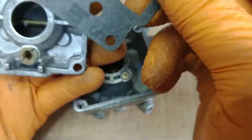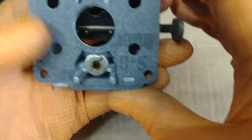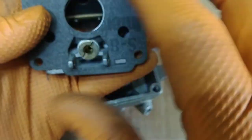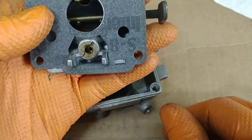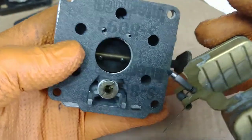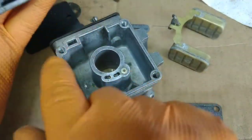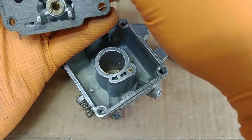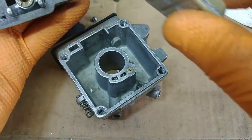Same thing with lining it up - you would actually put the gasket on the lid. Here again I'll put it on backwards. Four screw holes are lined up and you would look at this and say that's lined up, that's fine, and now you can put your float in. But you would be blocking the fuel again because you're 180 degrees off. The fuel inlet lines up with this - this is the way the carb would go. So you need to make sure that it lines up.